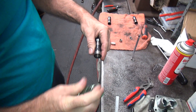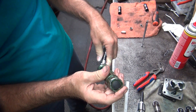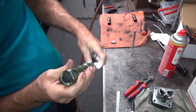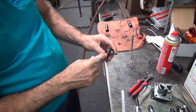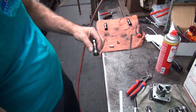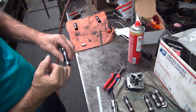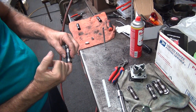You can see the oil flow right there — see how deep we are, pretty far down. You've got at least 20 flats to get pressure. If you only run in just one flat to keep the noise down, you have no oil to the bottom piston. And going the other direction — when it's all the way down, you shut the oil flow off. So if you adjust it for bottomed-out conditions, you're not getting any flow to the top end. So you want to be about halfway open — that's about all you want.